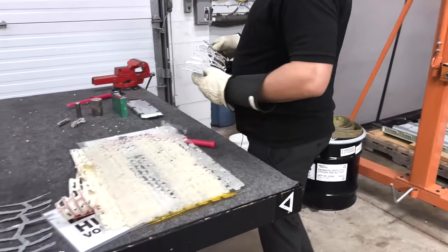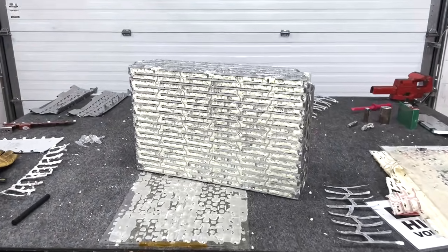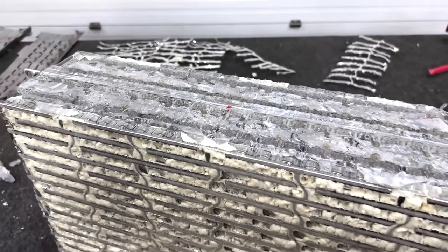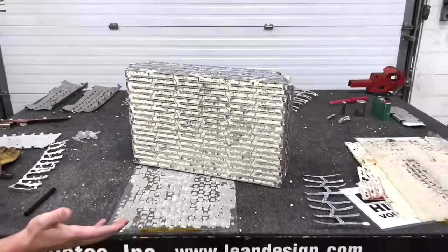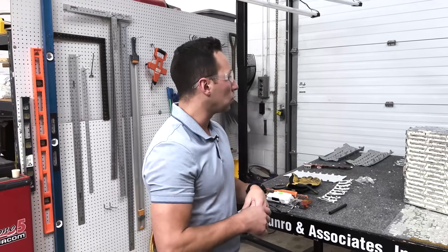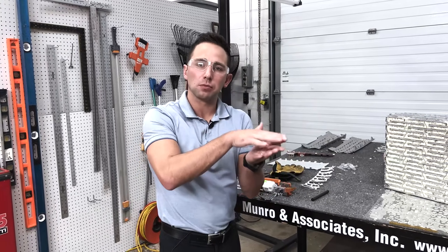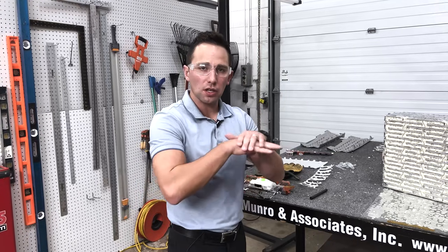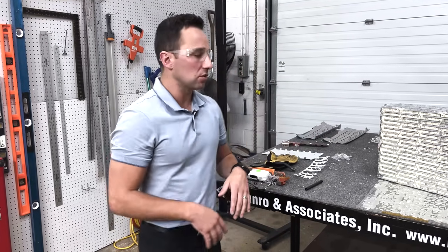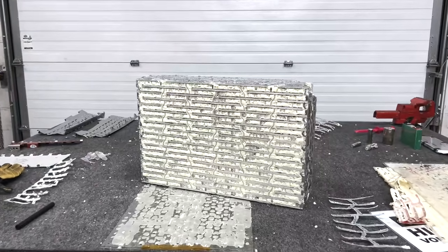Let's talk about the build process — the bill of process — and also touch on the thermal management aspect. When I look at what's on the table, I see three primary elements: two halves of the module, upper and lower, joined together in the center by a thermal management or cold plate. Similar to other applications we've seen, they're running ethylene glycol through a brazed aluminum stamped enclosure which provides cooling circuits, getting coolant and thermal exchange to the tops of one segment of cells and the bottom of the other segment of cells.